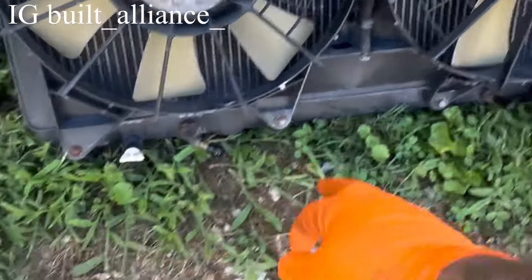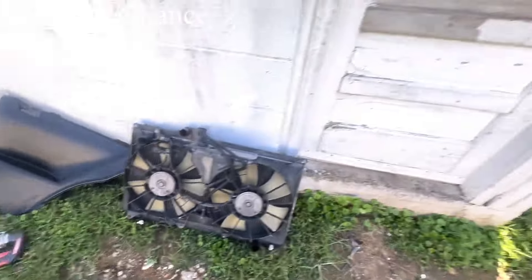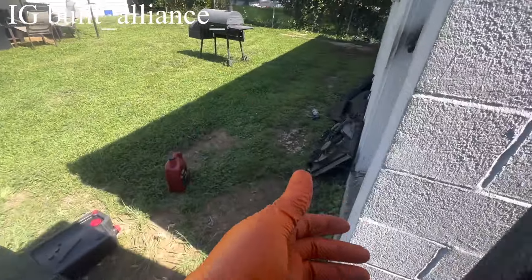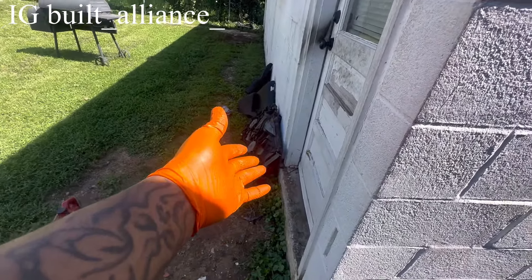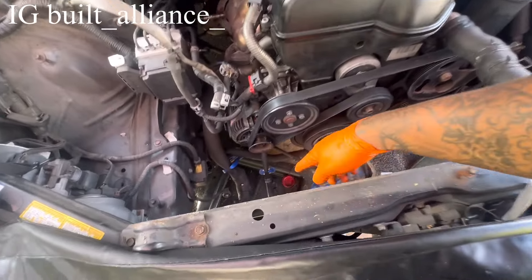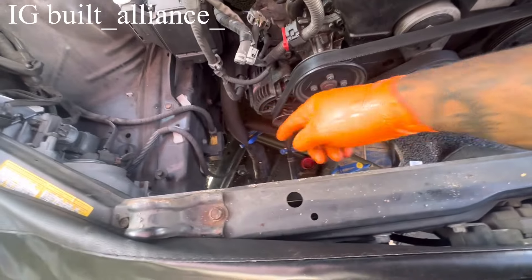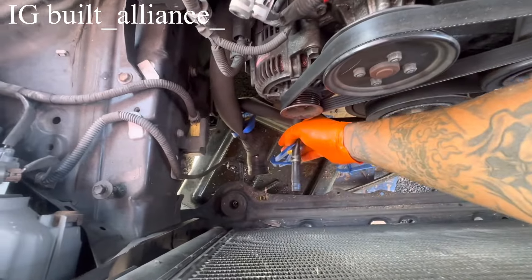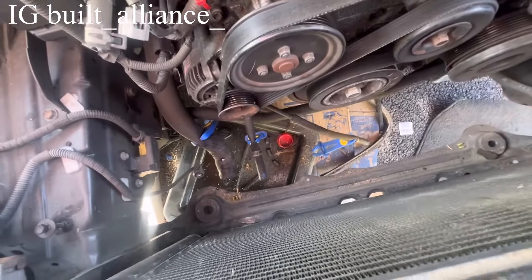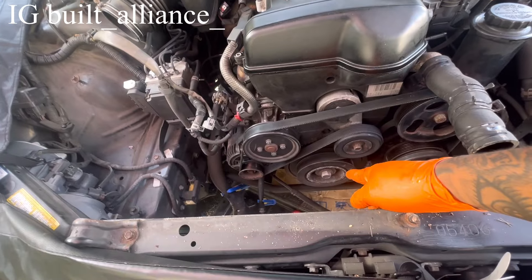There's still transmission fluid in the radiator so I put little vacuum caps on the lines so they don't leak. If this was a manual swap, we'd just keep the OEM auto radiator and cap those off. These two connectors go to the fans — this is the fan controller and this is the coolant overflow. I try to include a lot of these little tools in the description because they help you not make a mess. You can see there's a lot of debris down there from the shroud.